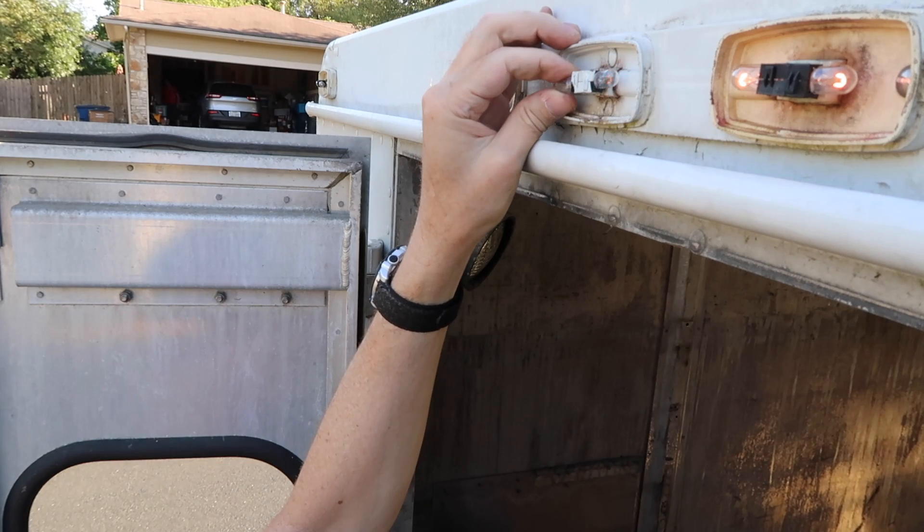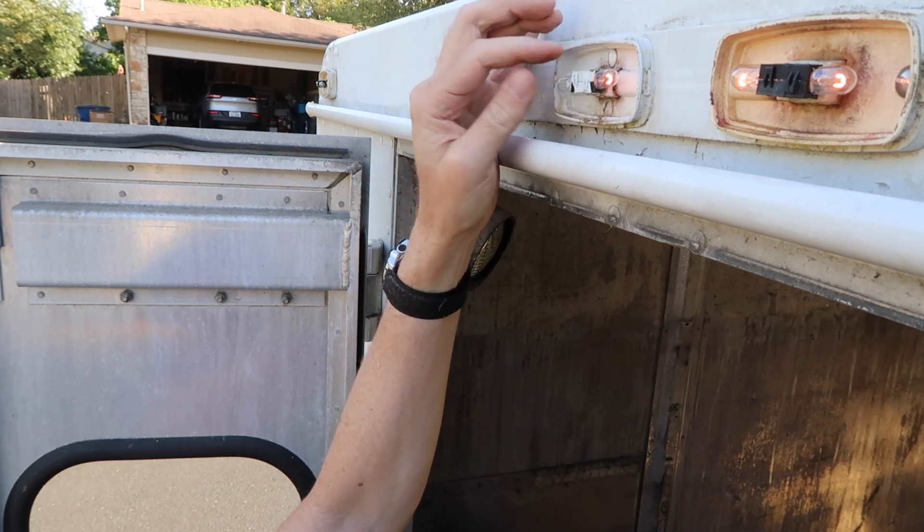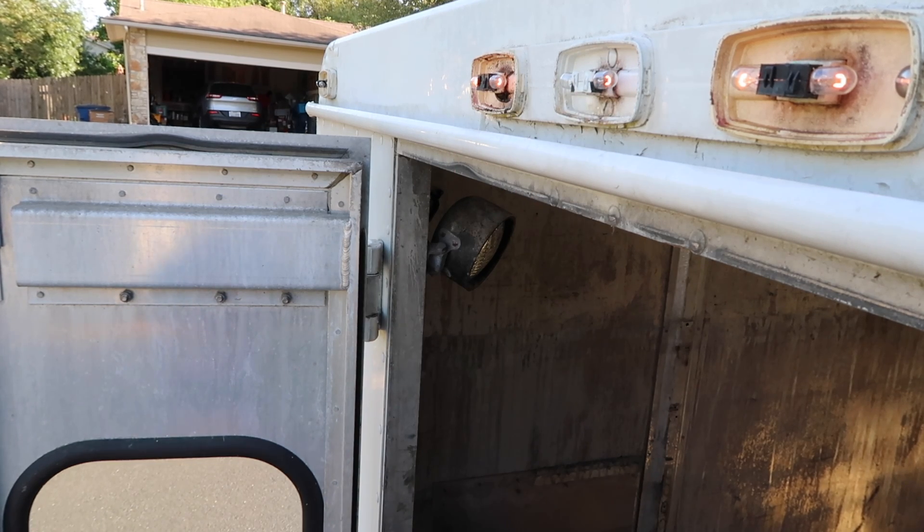I think I have power coming into this connection but just a really bad connection. I'll have to get some of that product you guys talked about for cleaning up connections. I simply am blown away — I got all ten lights working! I replaced all ten bulbs, and then it looks like the backside bolts connecting through the body skin were rusty. Just by twisting them back and forth, they made good contact. I need to get some electronic grease, pull the nuts off, replace the rusted nuts with nylock, and put grease in there — I think that will eliminate this.